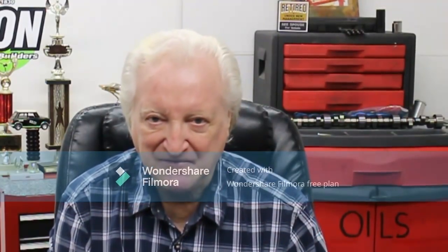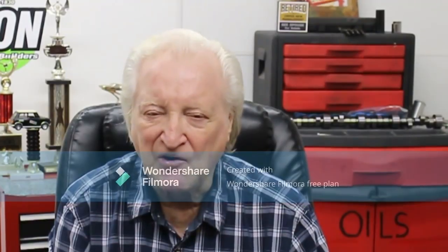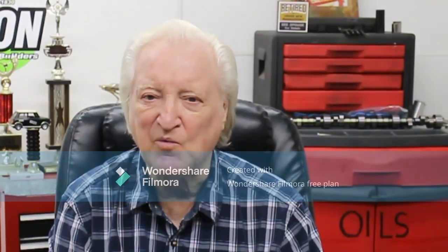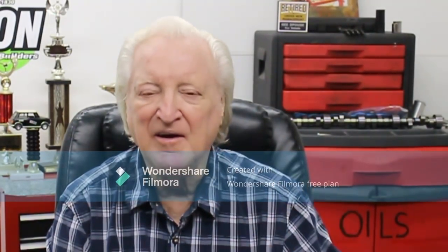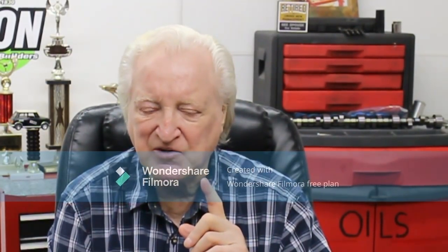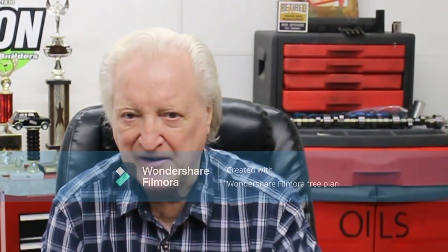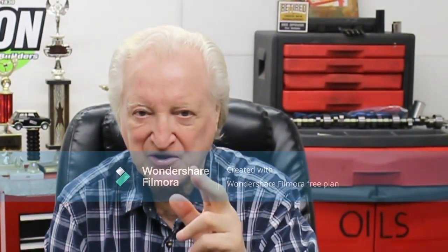One of the things we have to contend with here is that on this Chrysler head there's not a lot of room for extra large valves. I didn't go with bigger valves in this because doing this head is the first time around for me and I wasn't aware of exactly where its strong and weak points were. So play safe — make the port work. The port has to retain good kinetic energy and flow well. That will mean it will make the best of the energy available to turn that exhaust turbine and produce the most boost with the least amount of back pressure — in other words, we're going to do it efficiently.